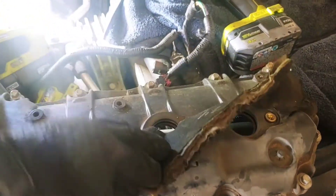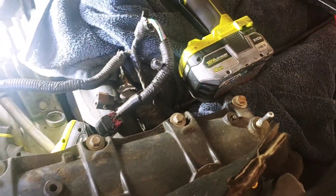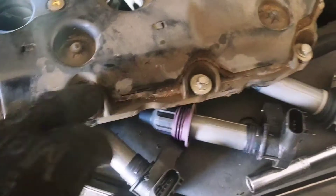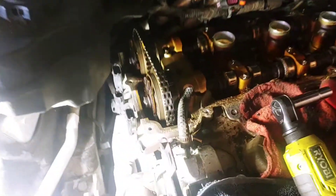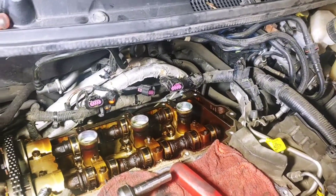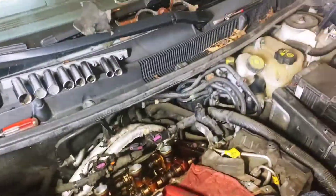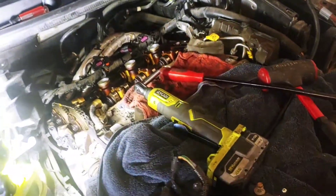You see the bolts. If you move this little deadener out the way, you can get a good picture of the bolts on the back side of the valve cover. As you can see, there's five, six, seven, eight, nine, ten, eleven, twelve, thirteen — thirteen in the back. Everything is pretty simple, nothing really to remove. So take the coil packs out, take the wires off — three wires up front — thirteen bolts, and you have your valve cover. I'll go ahead and get that covered up and we'll get these valve covers replaced and put back on.